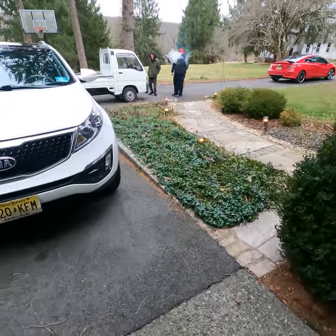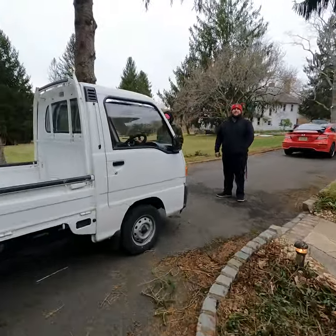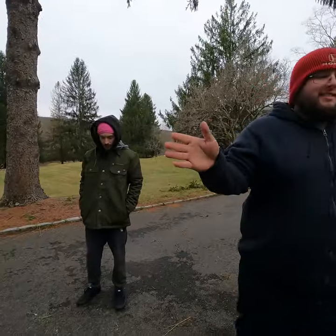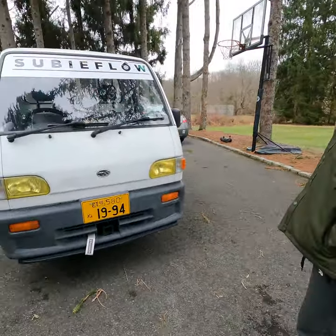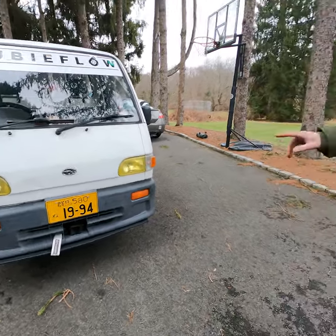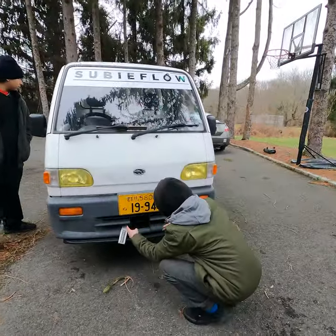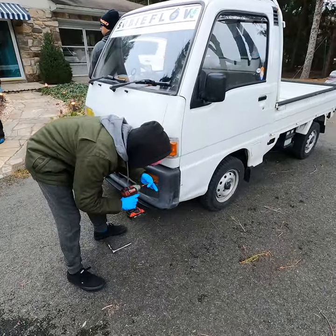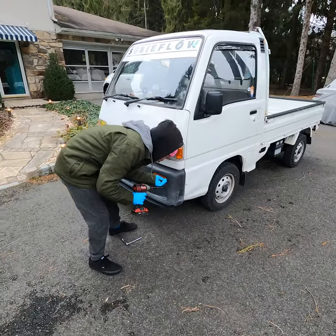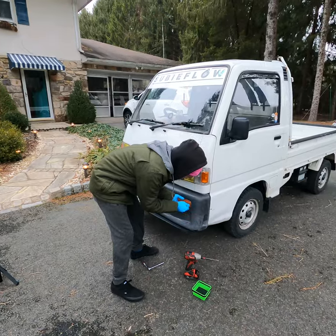So today we're gonna work on this on-bar — Dan wants to put a light bar on. What's up, how's it going? Not bad. So the plan for today is to put a light bar on this thing, right Dan? Yeah. So we're gonna pull the bumper off, try to take that hitch out — it's like two bolts — and then hopefully get it somewhere behind the grill back in there. Right now we're just taking out the turn signals on the bumper so we can take the whole bumper off to get to everything nicely instead of cutting. Yeah, it's cold.